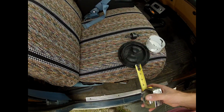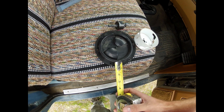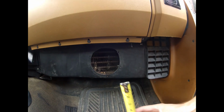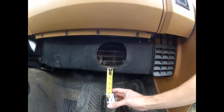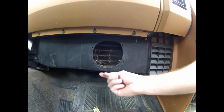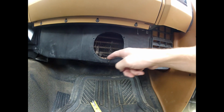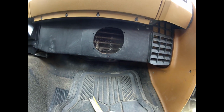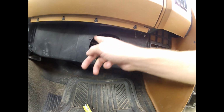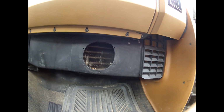So if we look at the back of the deck plate, from where you're going to need to cut the hole to the bottom edge of the deck plate is about 5/8 of an inch. So that means when you're bringing it down here, you need your hole to be at least 5/8 of an inch up from the bottom of the heater box. If you go too low, your deck plate lip is going to hang over and it just doesn't look very clean. So get this bottom edge of the hole at least 5/8 inch up from the bottom of the heater box. Once you do that, cut your hole to the size of the deck plate, or if you just buy the hole saw from the link below, that's the easiest way to go.